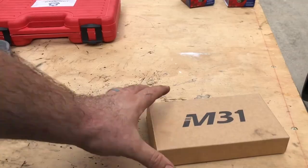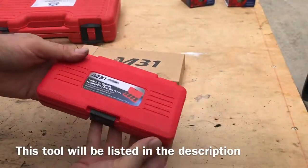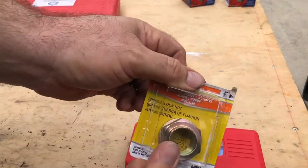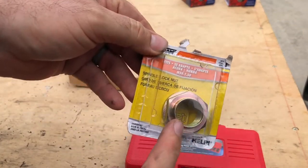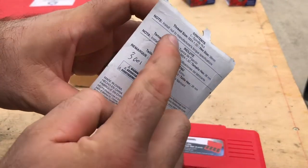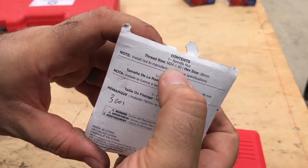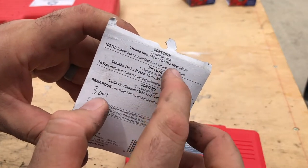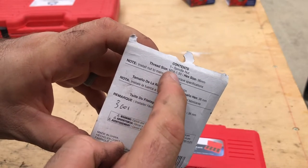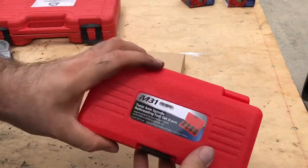I'll put the kit in the description where I got it. I went ahead and got a new spindle lock nut for my axle. You look on the back and it'll say the thread size — mine says M24-1.50. It also has the hex size for the socket you need, but M24-1.50 is the size you need for your die set. Whatever it is for your car, look on the back and you'll see the thread size.